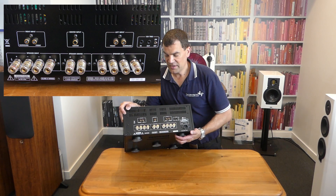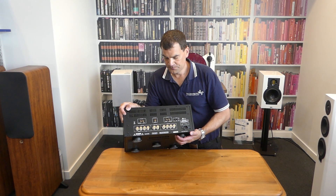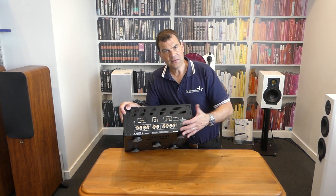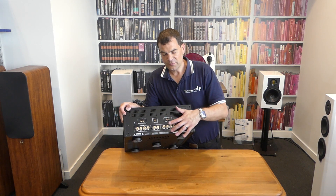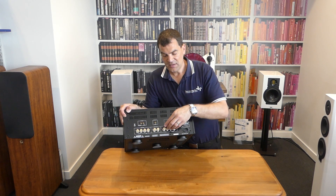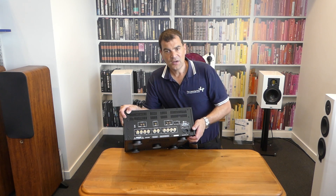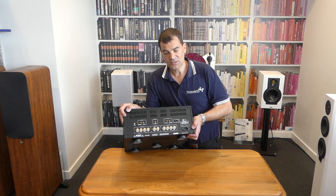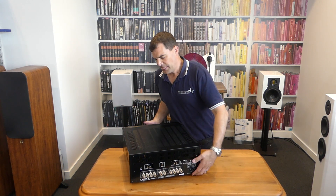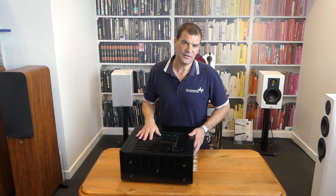The binding posts are clearly labelled and very easy to connect. One of the reasons Rotel has grouped the front inputs together is in case you choose to bi-amplify — you can use a simple Y adapter to take one output and bi-amplify and bi-wire your front speakers, giving a useful improvement and doubling the wattage while maintaining total harmonic distortion. This is a lovely power amp and I must say how enjoyable it is to add one of these to an AV receiver.